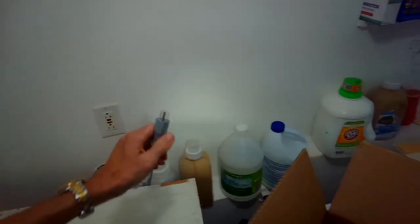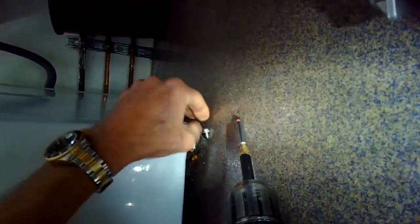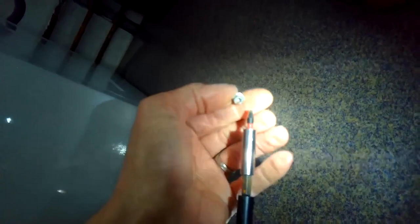So we're going to unplug it. I'm going to take out these Torx 15 screws on the front right and front left to remove the lower panel. It's pretty easy to get these out if you have an extension.